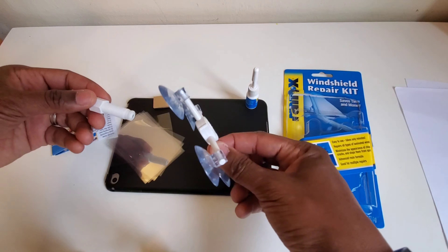Also in the kit there's a razor blade, because this resin dries like crazy glue and the blade is for scraping off the residue around the cracks once it's dry. You put the assembly over the crack, move your car into sunlight, and wait about 20 minutes for everything to dry. Then you peel off the plastic sheet and scrape off the white residue — the same kind of white film crazy glue leaves. The application base with the four suction cups goes against the windshield, the reservoir screws in, and it delivers the resin — what I'll just call the juice — right onto the crack.